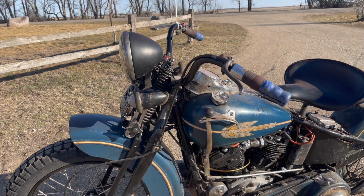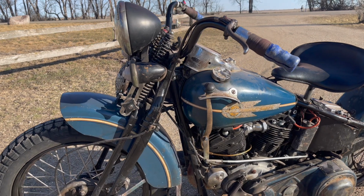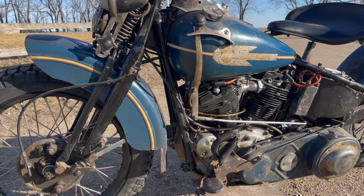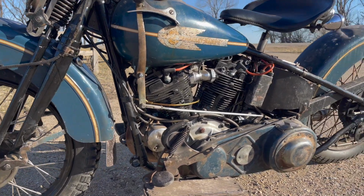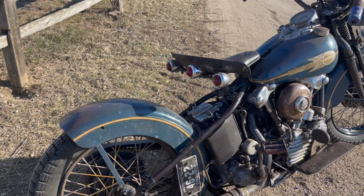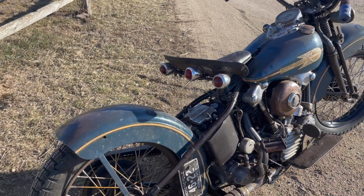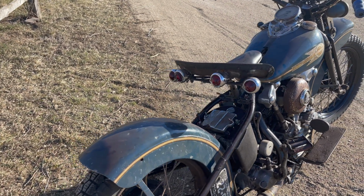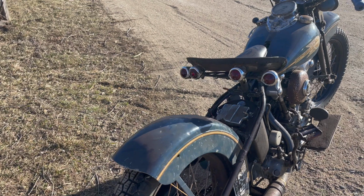The manifold is a cool old custom one that has a 4-bolt flange added to the original smaller early manifold casting. The bottom end is 74 stroke with original rods and custom pistons with a different pin to crown height. Cam is a Linkert Weber number 1 that has more overlap than stock but isn't too radical. It runs good and is a fun combination.